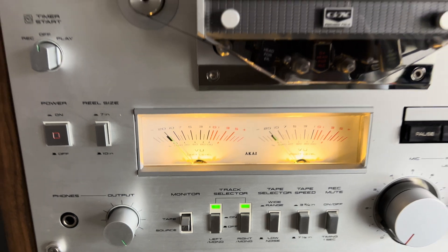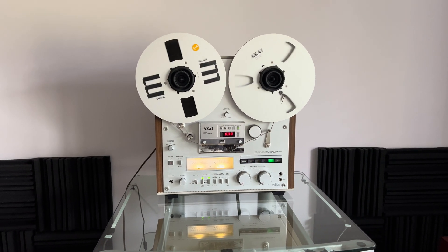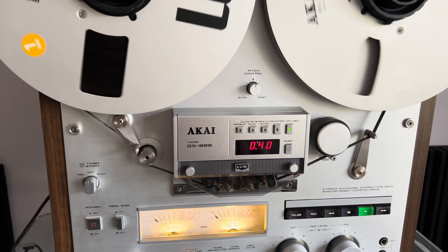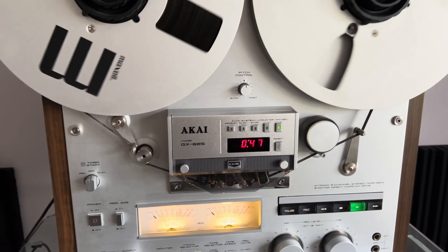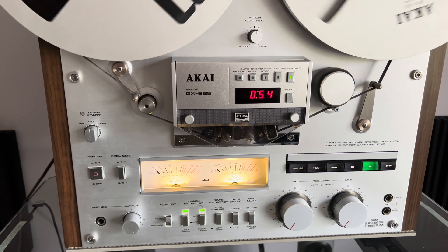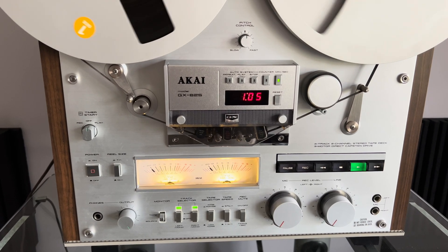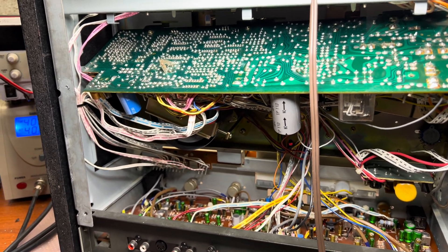Now I'll load it and see if it works — and as you can hear, it does! It's playing some recorded music on this tape. I'm glad that the 36-volt surge didn't do any harm to the logic or control board. If I had known early on that this ground connection was unstable, I could have prevented all of this. I highly recommend doing this preventive maintenance before your deck gets burned. Thanks for watching — hope this helps you, and enjoy the music!